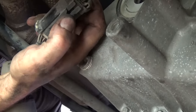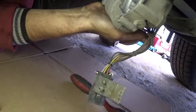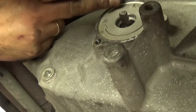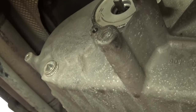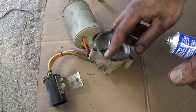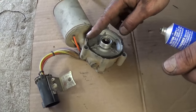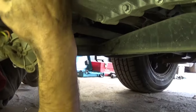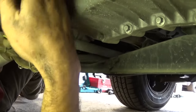Now you need to unhook the wire — press down and pull. This is the motor, and this is the one that doesn't work. Now we need to clean all the silicone off right there. Clean it good — use some kind of solvent to clean it so it's not greasy. Then get a silicone gasket maker and apply a thin layer all around that circle housing right there.